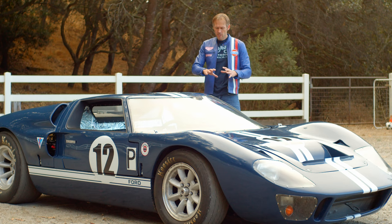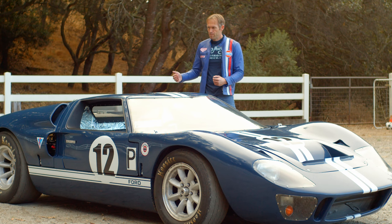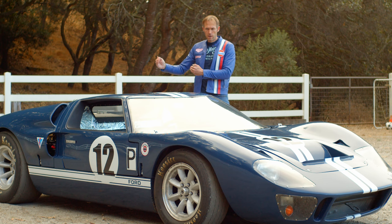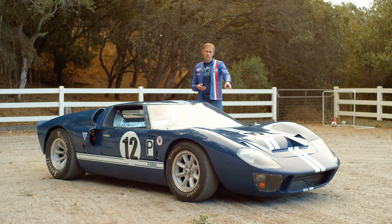After the event I got the car home and the first thing I did was look for the braking problem. I did a four-wheel alignment with string, which I'd done before but not recently, just to make sure I was doing things evenly when making alignment changes. I found the rear wheels were about an eighth of an inch further to one side than the front wheels — not a lot, but I corrected it.